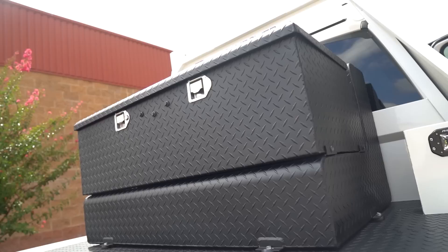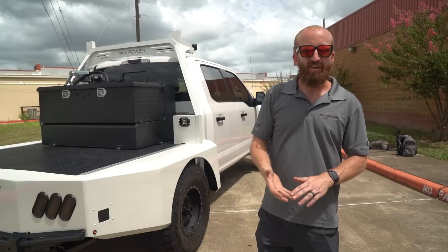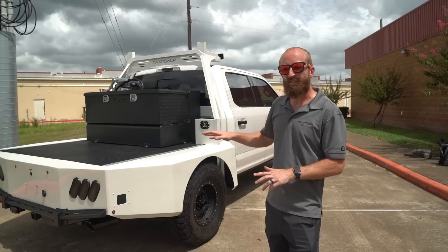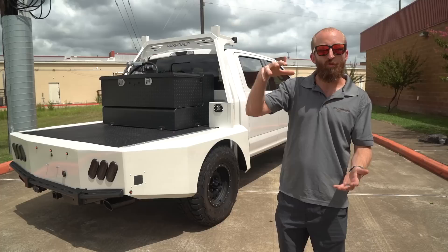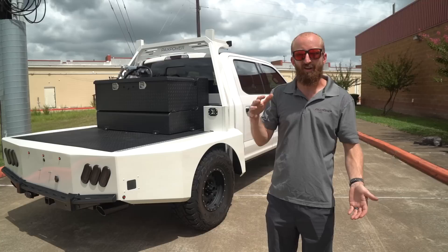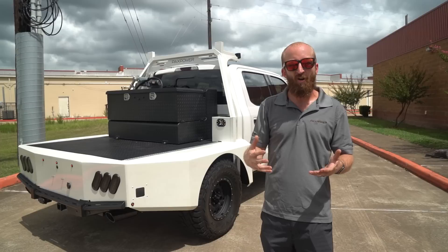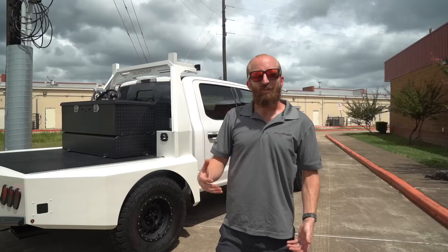This one is configured for a 90-gallon fuel tank, but a future one could be configured for a welder, snowmobiles, or even a flatbed camper. All of those are obviously very heavy, which a Raptor doesn't deal well with. So to address that, we put what we're calling our mid-travel airbag system on there — a set of 5,000-pound airbag springs that is not connected at the bottom of the bag and still allows full droop travel. Using its integrated bump stop, it provides almost full up-travel as well. If you need to carry something heavy, you just use the onboard compressor, add air, and you're ready to haul that load.